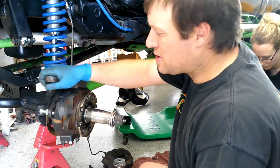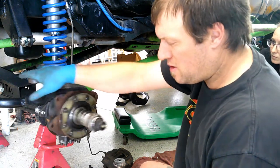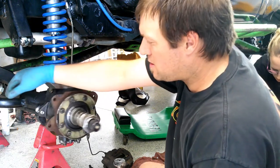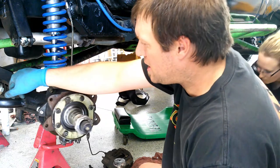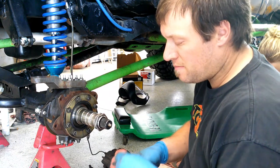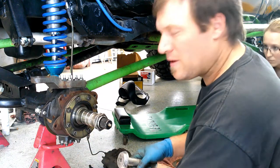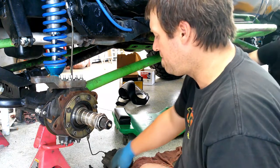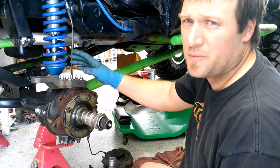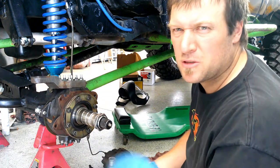Everything's greased and everything feels good — I'm just shaking it to make sure it feels like it should. You want to have a little bit of tension on it but not too much — it wants to be turning. Grease seems to be doing its job. For trunnion bearings you always have to keep in mind that you have to shim those if you take them out — pay attention to the shims, they're important. With the eliminators we had to shim them as well, but in this case we didn't really take them fully apart — we just had to lift the arm a little to get the knuckle off, so we didn't have to reshim. They're metal shims so they don't fall apart.